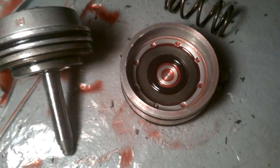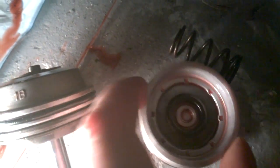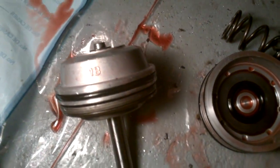Once the circlip — the snap ring — is out, I had to twist it a little bit and give it a kick. Make sure once you pull the clip out, keep your hand on it because sometimes it just pops out and the piston follows. Especially if you have the splash shield on the car, you don't want to search for it — just keep your hand there. This one came out pretty easily.